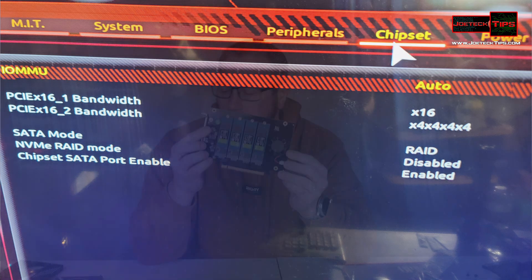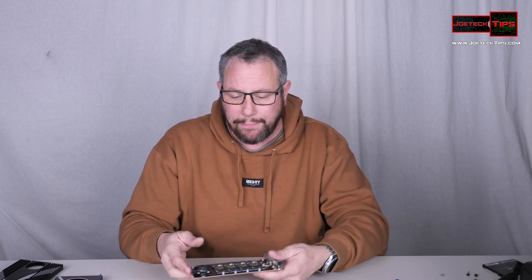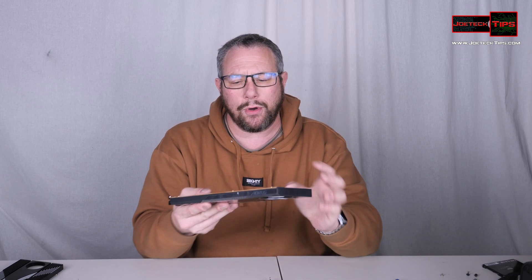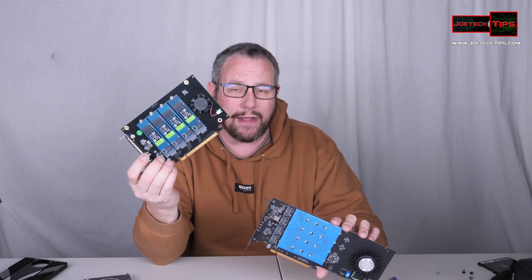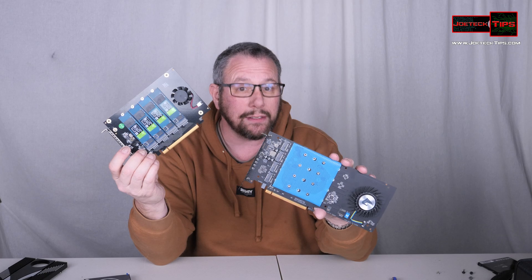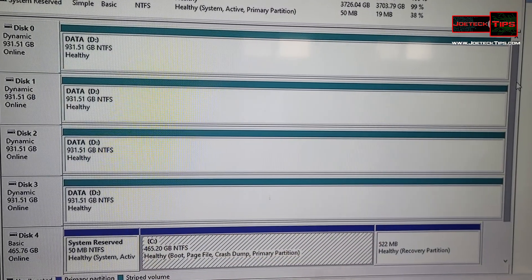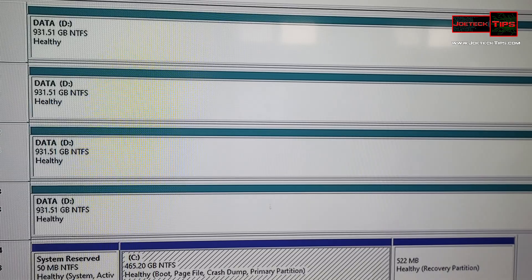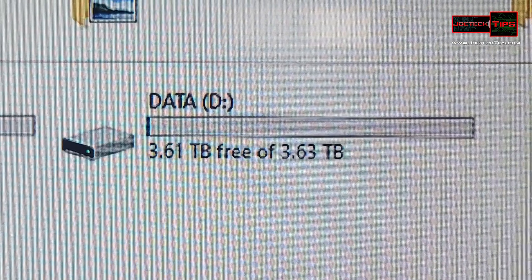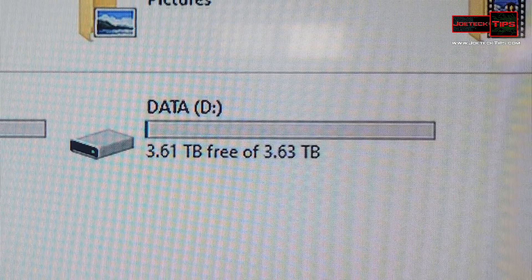So I will show you — this is actually pretty cool. Gigabyte makes their own as well. The motherboard that I received does the same thing. I take these drives out, pop it in here, and it's also seen. There's no hardware RAID here at all — they're just pass-through devices to be seen, but it needs bifurcation in order for this to function.